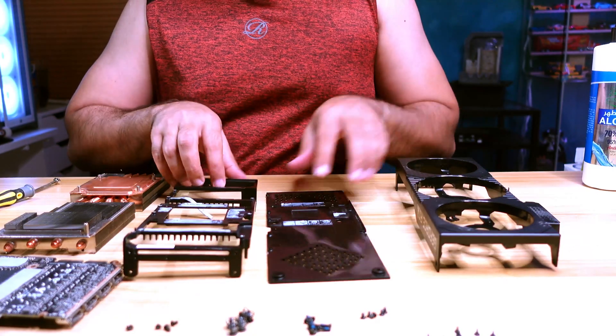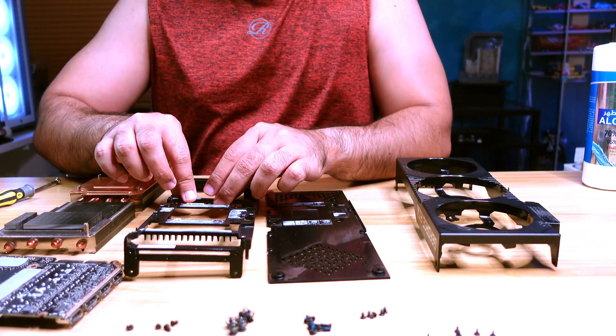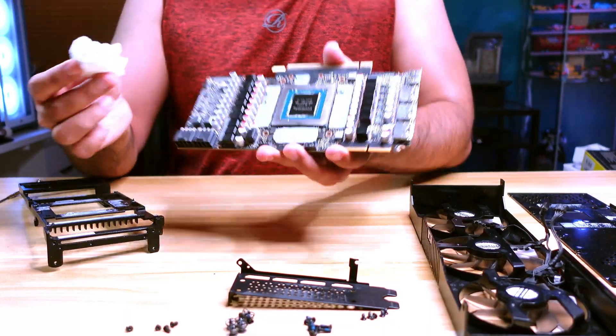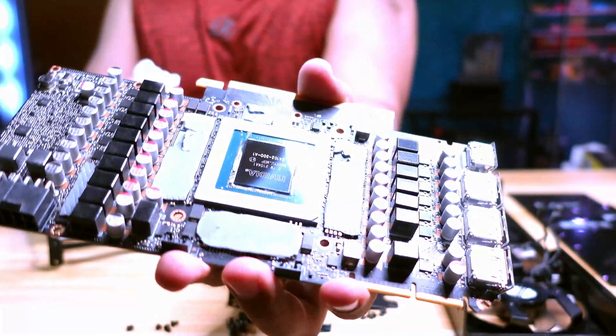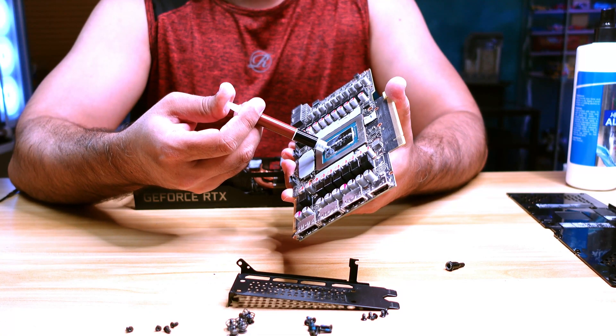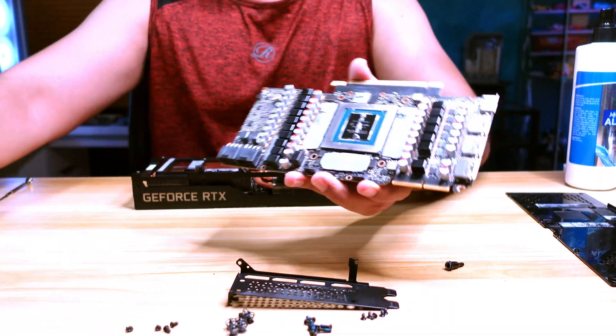I'm back after washing the non-electrical components of the GPU with soap and pressure wash and blow dry. You can clean the main GPU chip by using only alcohol and a microfiber cloth. Carefully apply the thermal paste — not too much, not too little. Here I am using the line technique again.